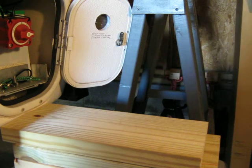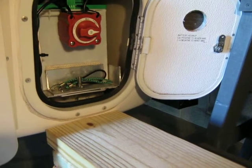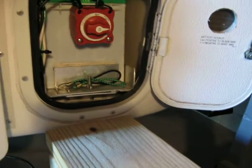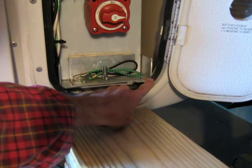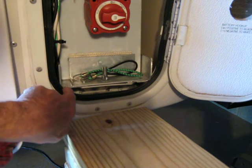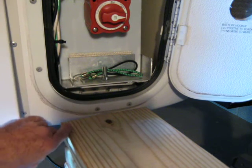When I first got the trailer it was a real fight to get the battery out. That's because the battery is actually slightly larger — by about 5 millimeters maybe — than the door opening here. What I did is I went in with my trusty Dremel and I cut this corner. It's cut down a little. This radius was still a little inside where it should be, so I cut that a little bit too.